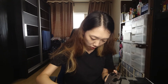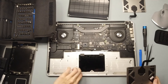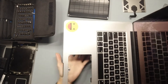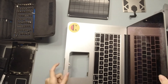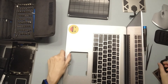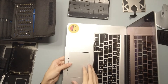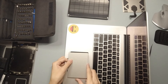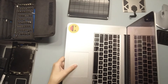The part that I did not anticipate was that this trackpad comes off from the front. I had tried to remove it but I couldn't figure out why. Apparently, you're supposed to open up from the top, and this is what you see — without the trackpad, it's supposed to sit on here. There's this thing over here which is supposed to control the trackpad touching level — I'm guessing sensitivity. So this one comes in like this and the whole thing just sits inside. You've got to put the ribbon cable in first and then slot the bottom in because there are these two ears here. Slot the bottom in and close it over the top like that — that's all.